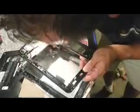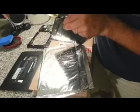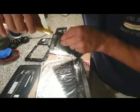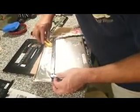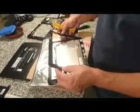There'll be a piece of tape also where the connector is — set that to the side. Now the only thing left between you and the screen is this cover — there's an edge border cover. To get that off, that's where you use your utility knife. You'll have to break the seam between that plastic and the actual screen. Once you get into that corner, from the rubber beveled edge into the screen, you work your way around. As you pry it open, all that's being held on is by some tape — the tape is holding that glass to the cover. Pry that open and go all the way around. Once you do that, the cover comes off.